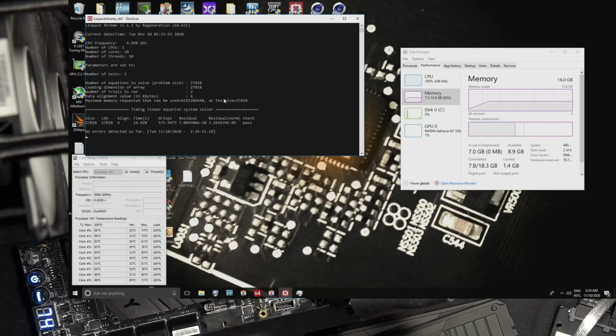And we're also going to test it when we overclock it, though I don't think it's necessarily going to go much faster than the current frequency. We're going to go in steps of 133 megahertz, just because the 133 memory ratios tend to be the most stable. So that's basically going from 3200. Yeah, 3200, 3333, which is a weird one because there's not really anything that is limited to 3333.